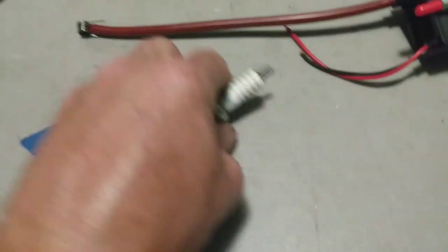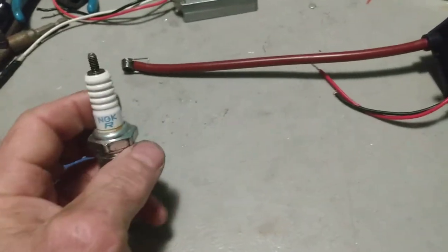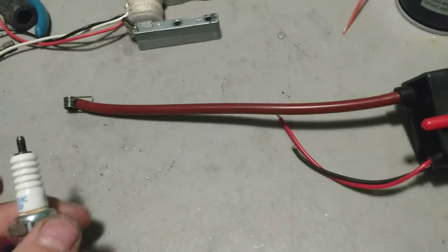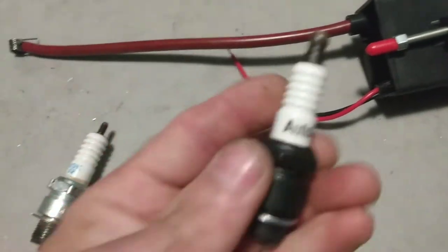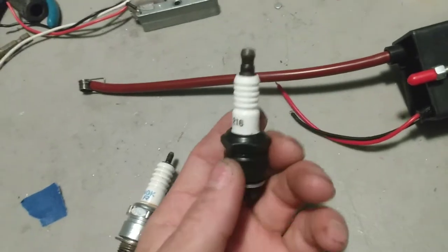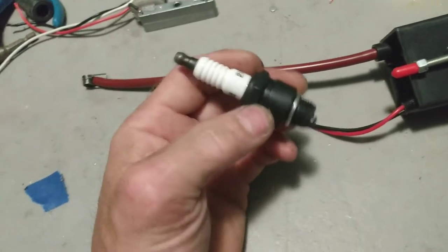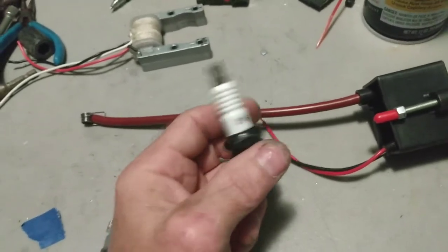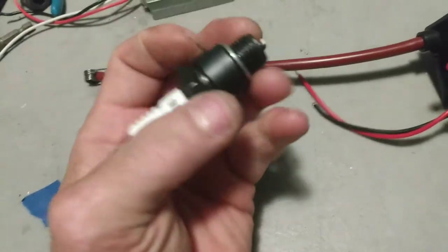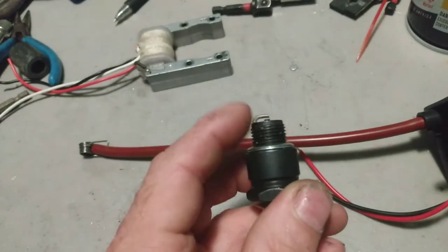Maybe his tires on his truck were different. Back to this — the 100cc has a single-piece cylinder. They call for the factory plug that came with it, but that was a garbage plug. This cross-references over to — I'm going to get a decent plug. I highly recommend you get rid of that junk plug they come with and buy something different. It cross-references like 70 different plugs. So this is an Autolite 216, and if you notice, it's the depth of it.